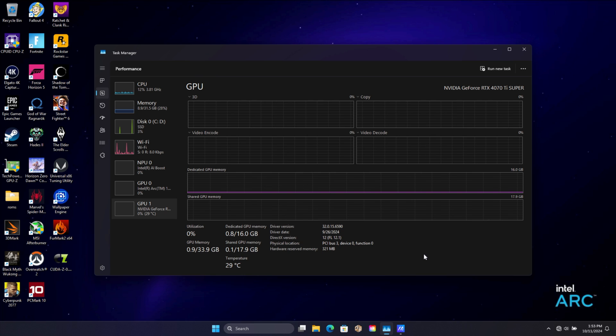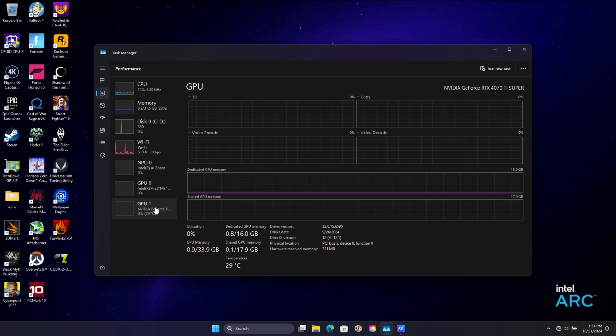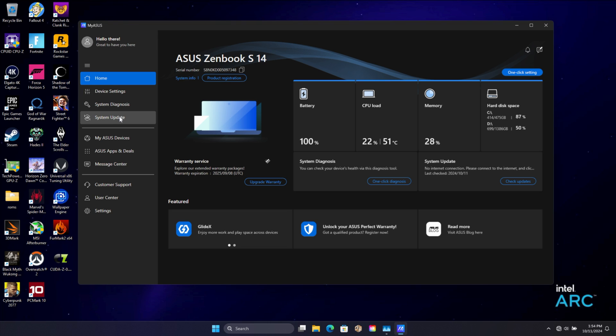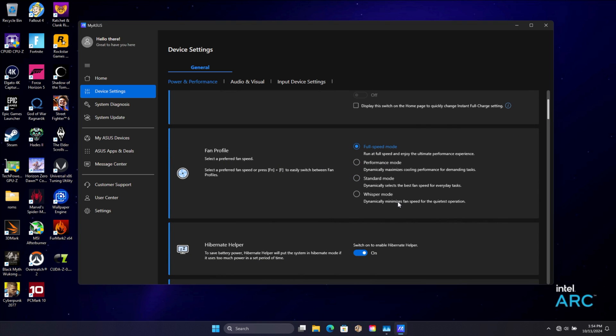This is probably overkill for an eGPU — I would recommend something like a 4060 — but I've got the RTX 4070 Ti Super with 16 gigs of GDDR6. I wanted to see what we could do here, and the CPU is actually keeping up pretty well. But remember, we're connecting this over Thunderbolt 4, so it's not going to be working at its full potential as if it was in a real PCIe x16 slot; this will do up to 40 gigs. To keep power up on that CPU, I'm using my ASUS, and in the device settings we do have fan profiles — Whisper, Standard, Performance, Full Speed mode — and this directly affects the TDP of that CPU. It's not going to kick that fan up at full speed all the time, only when it really needs it, and this thing doesn't get that loud.